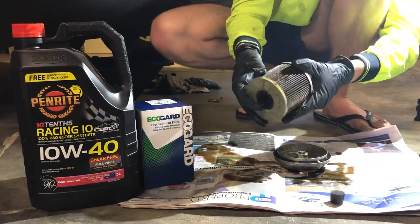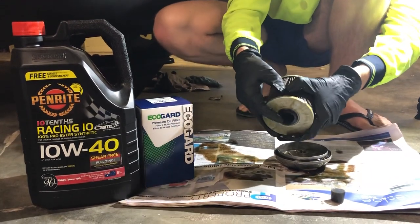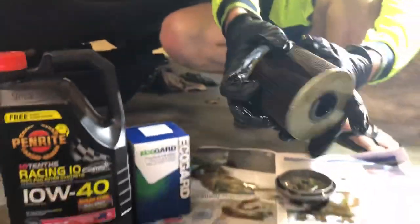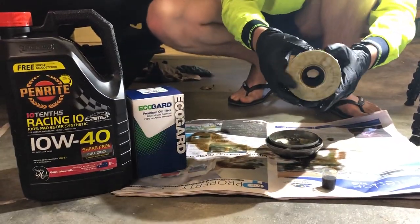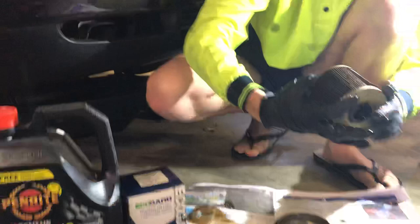I'm not really putting that much pressure on it. Let's try it at another spot. You hear that — that does that again. And if you look closer, that is the paper pleating starting to break with just very light pressure. And try again — look at that, that breaks very easily and that's not the glue. The glue stays in there with the tip of it, but the paper pleating is breaking.